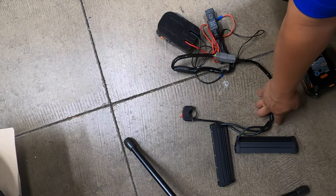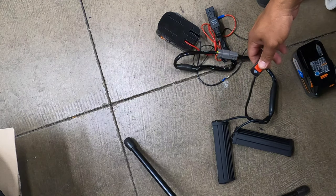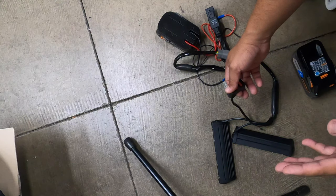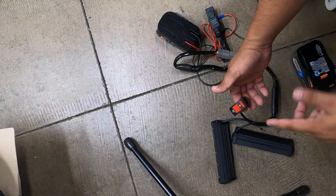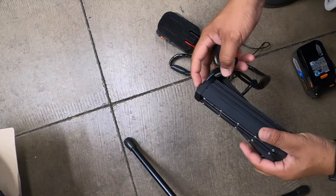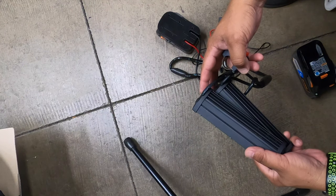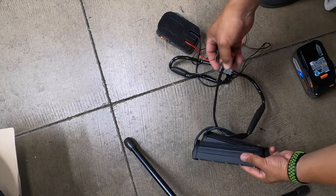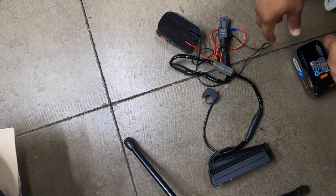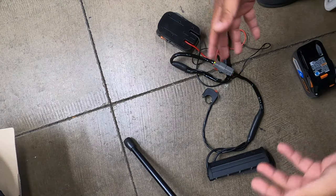I wanted to make everything quick-connect, except for the lights which I hardwired into the whole harness. I have a light switch here — originally I wanted a three-way switch so I could turn one light on or both on, but right now they're wired so both turn on at the same time. The brackets are mounted on the front of the bike, they're adjustable, and both are pointing somewhat down and out front so they're not really blinding — as you can see from my last video, I only had one then, now I have two.